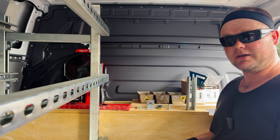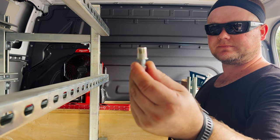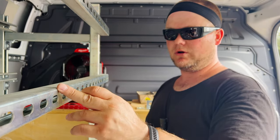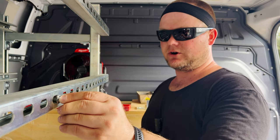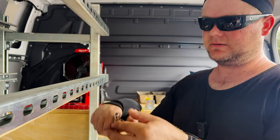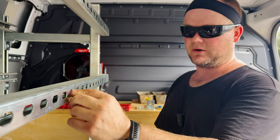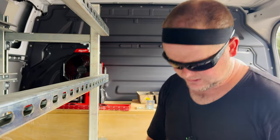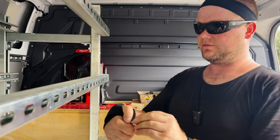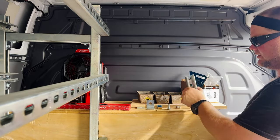The first thing I needed to do to attach the horizontal super strut to the van was use what we call riv nuts — it's a rivet-style nut. It is inserted into the wall of the van and then a special tool is used to crimp it, pulling it back and squeezing down on it so it crimps up and makes a solid mounting point. That was the main first starting component — the riv nut into the van.